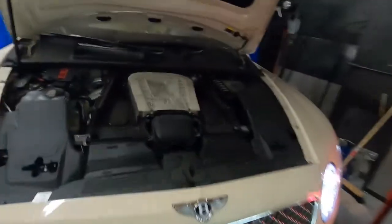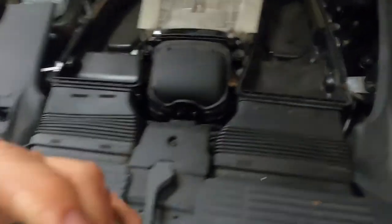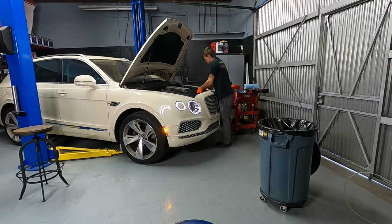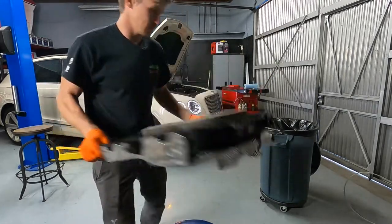To get to it, I don't think you need to take the top cover off the air box — although this does need an air filter badly — but you need to take off these screws here, and this will pull up and off. This will just pop down on there. What we're going to do is pull these back out of the way, pull this up, pull this one back out of the way. Now this is going to tip up and slide back — it slides on the back on these two little points there. Super easy.